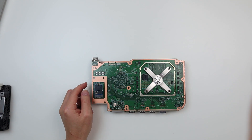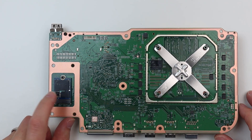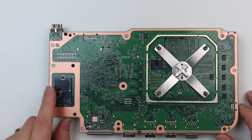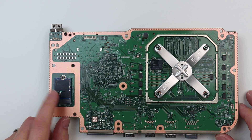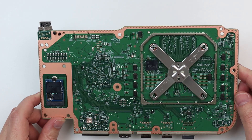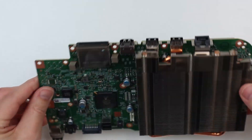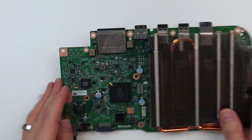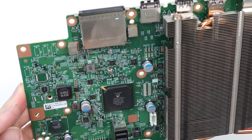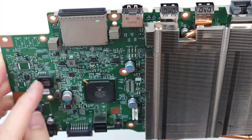Let's take a walk around. We've got our internal storage here which is removable, which is great - a really good idea from Microsoft to make that exchangeable, similar to the Xbox Series X. The X-clamp on this is pretty much the same type you find on an Xbox S. Looks like we've got a RAM module there. On the other side we can see a southbridge - appears to be an M113 9994 by what I can read - and various power supply components around the board.